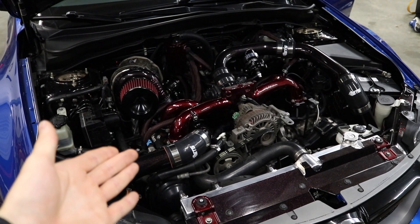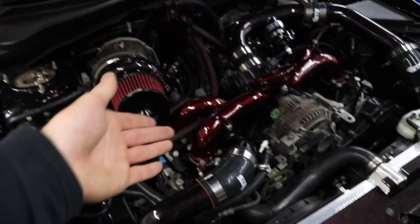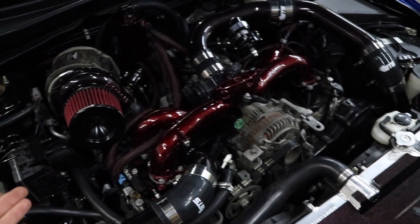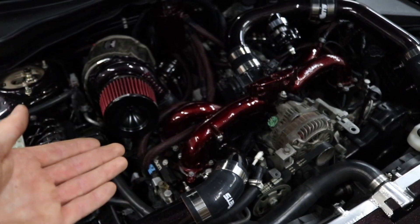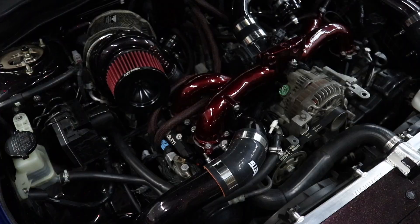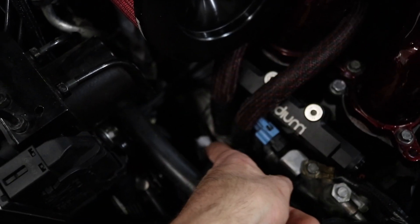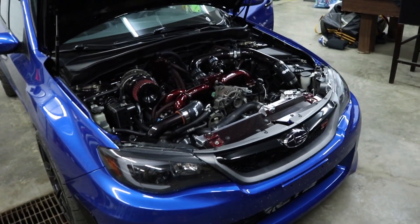It's insane — I didn't even need to take my harness apart because I realized I'm dumb. Your injectors all share the same power wire, and I don't know why I totally missed that when I was literally showing you guys the diagram. Since they all share the same power wire and only have their own individual grounds to the ECU, literally all I had to do was unplug the cylinder one injector wire, route it to cylinder three and plug it in there, then route my cylinder three injector plug to cylinder one and plug it in there. Misfire fixed. She is perfect now and she hauls — it's insane how much more torque this thing makes now.